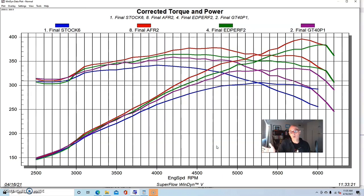So why spend all that money on the extra flow potential of those heads unless you're planning to go from a 302 to a 347, 331, 327, 351, or even something bigger? Think about that for the future. Also think about what you're putting them on — if you have a junkyard motor, why spend money on CNC-ported heads when you're going to make about the same power anyway? You could buy a Ford Explorer 5-liter with GT40P heads, do a little porting, add springs — all for less than the cost of one set of aftermarket aluminum heads.